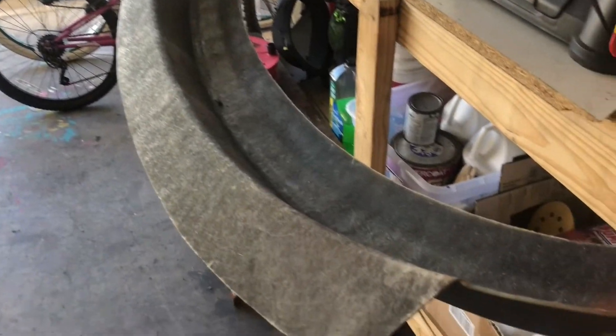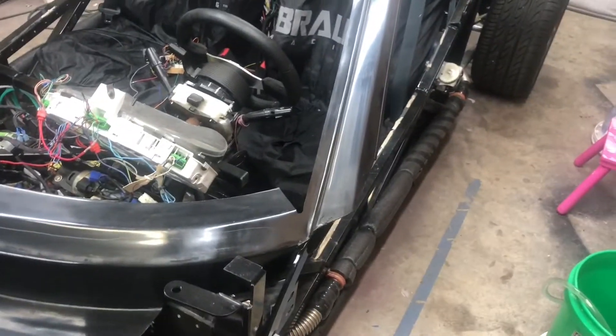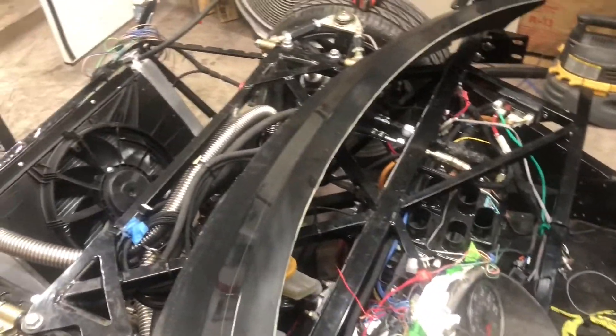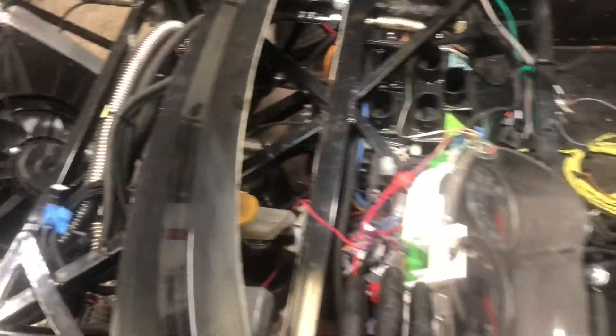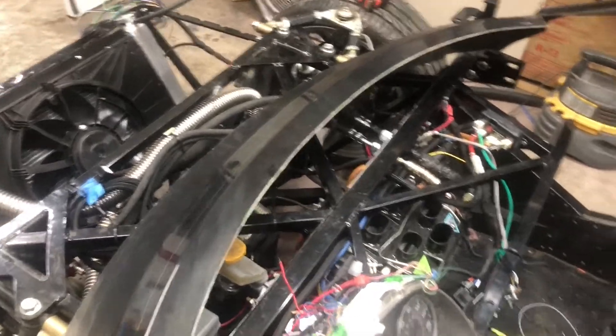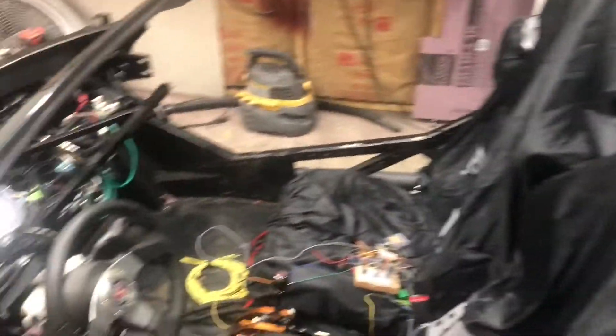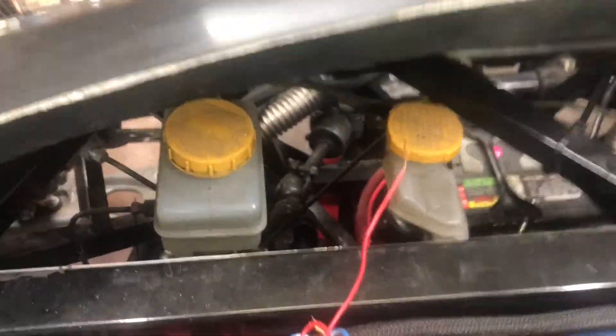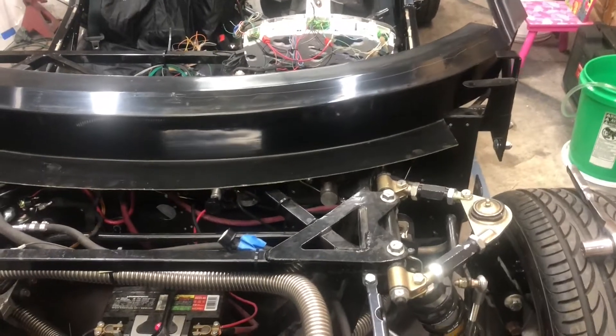First step in body — I've got the windshield mounted. If you go by the Factory Five manual it's probably the last thing you do, but I need to do it for several reasons. First, I'm getting ready to put the dash in and I know the factory dash is going to be short, so I need to fill the gap. I also want to make a custom hardtop so I needed to know what the roofline was going to look like. And my brake and clutch master cylinders are up under there — with a dash in place I can't get to them from this side.